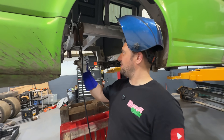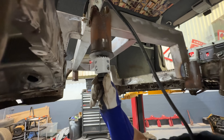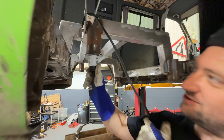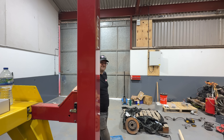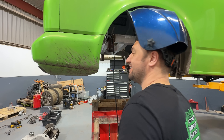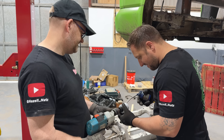I've just tacked some nuts in here — some M6 nuts. So now the hole saw is positioned centre and it should keep it fairly still so that we can drill these bad boys out and it's not going to wander everywhere. I'm telling you, this drill is going to be a treat — I just scratched it there and it nearly cut through.